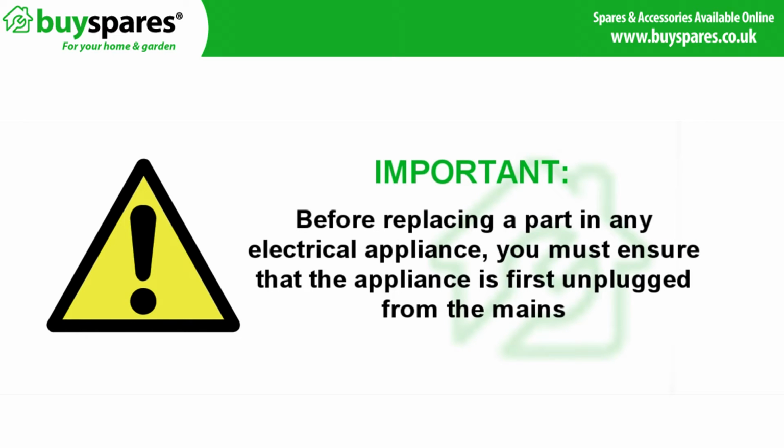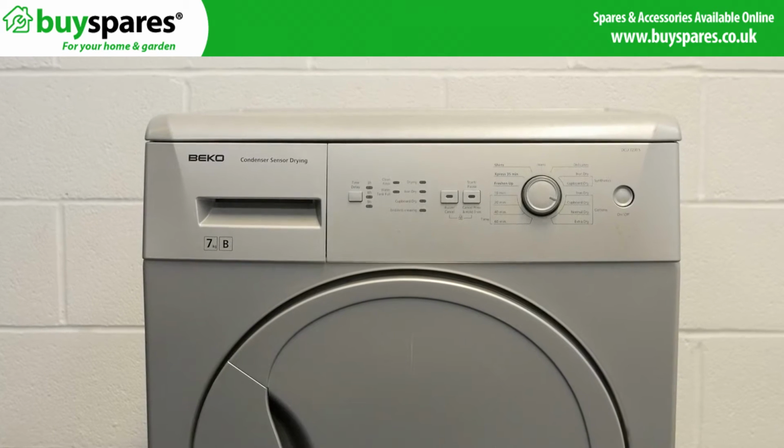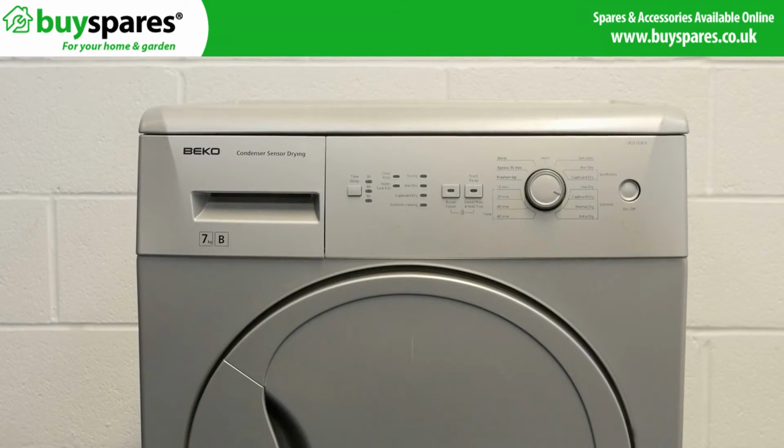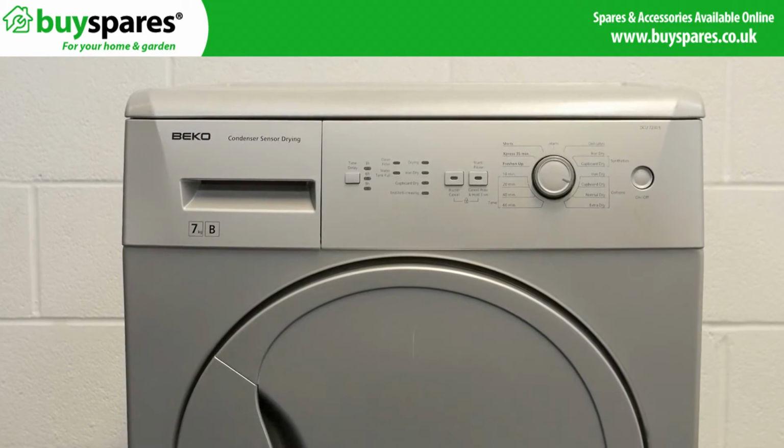Important: before replacing a part in any electrical appliance, you must ensure that the appliance is first disconnected from the mains. A faulty sensor may result in your dryer not heating, but make sure you have checked the heater and its thermostat before suspecting an NTC has failed and needs replacing.